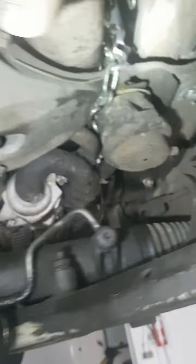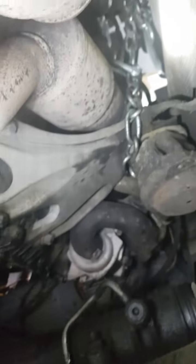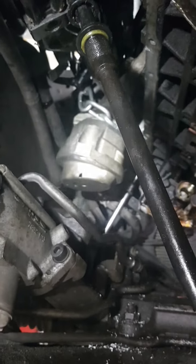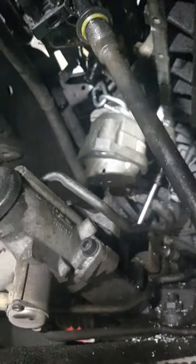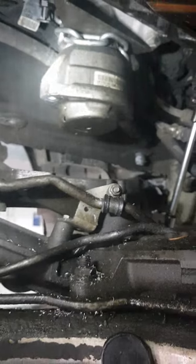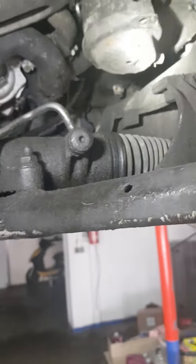Then it was free to just take the oil pan down. As you see, something is missing here — the house for the oil sucking — because this was in the way, with three screws at eight millimeter. I hang the engine first some millimeters up on the roof with this metal. I'll show you from the top. I hang the motor up first, then I open the two screws on both sides for the engine holder — motor lager. There were two screws on top, small at 8 millimeter, I open both sides and then lower the engine down.